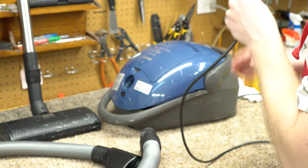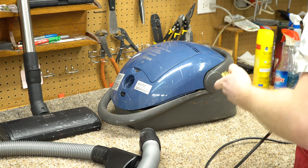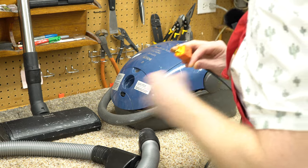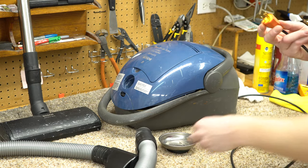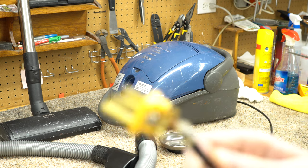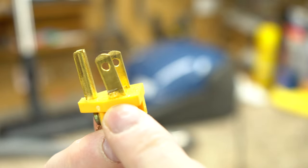This plug is too loose for me to feel comfortable plugging it in. So first thing I'm going to do is check this aftermarket plug — and man, it's been zapped. You can see the plug is melted right there, and the reason it's melted is this plug was not really put on right. So it melted back.